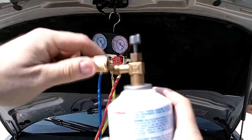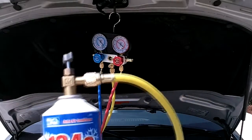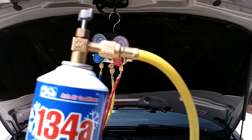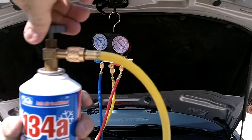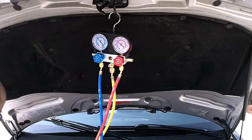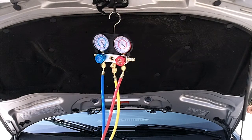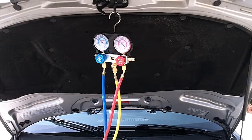I'm going to screw this on — this is the adapter I was talking about. My mechanic friend lent me this valve to borrow — that was seven bucks — and my neighbor just gave me this can of refrigerant, which was almost 20 bucks. So thanks a lot for helping out. We're going to screw this in and puncture the can, then back it out just a little bit. We'll open up the low line and the high line, then start up the car, get the AC going, and crack open the low line to fill it.